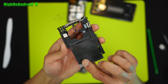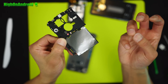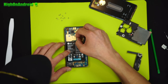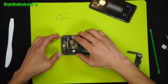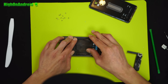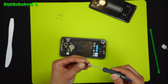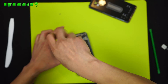The US models do have wireless charging — this is the wireless charging unit, which is kind of cool, but you do lose the hi-fi audio that the Koreans get. Next, put the battery back in and also connect the battery connector. Carefully place the top plastic assembly back on first — it should all snap into place easily. Then put the bottom speaker assembly back on. Lastly, go ahead and screw all the screws back in — that is 11 screws total.